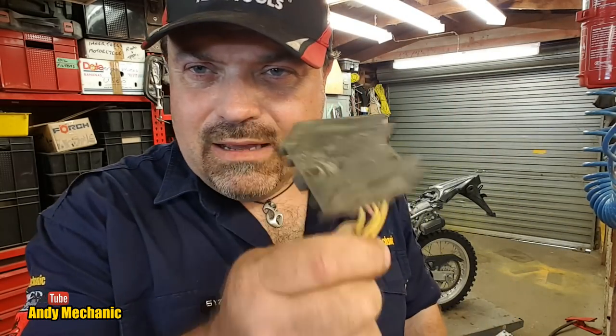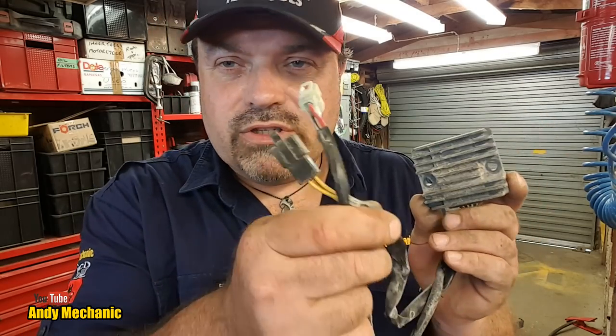We've tried the bike's original regulator, which was this one here. That was obviously faulty, that's what flagged the fault to start off with. We then grabbed another one from a donor bike outside that was exactly the same part, put that on, that didn't work either. If anything, it was worse. All we have left is this one. This is the one that's got the two plugs. We don't want the two plugs, we want one with a single plug. So, without spending any money, what I now need to do is swap the plugs across. I was almost going to say maybe we should just use some fly leads between the plugs just to test it. We could do that. It's going to involve five fly leads.